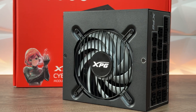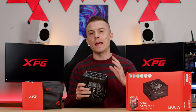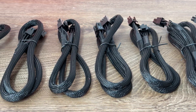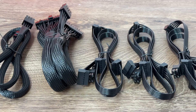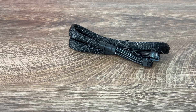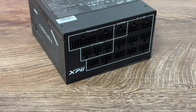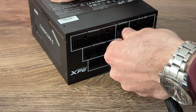This power supply is fully modular — the cables are detached from the PSU and you attach only those that you need. Let's check out what we have here: 10 eight-pin (actually 6+2 pin) connectors for CPU EPS or VGA for graphics cards, one 12VHPWR cable, three SATA and Molex connectors, and the motherboard cable which is 18+10 but connects as a standard 24-pin. It's well organized and simple to connect.